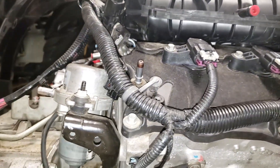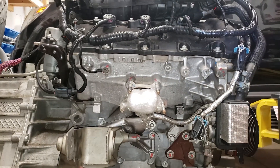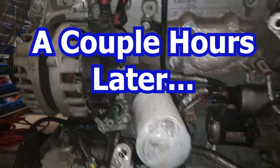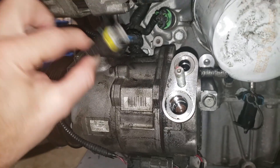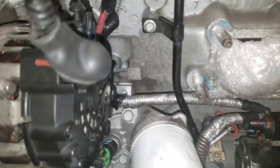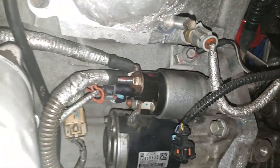This side of the engine is pretty close as far as connections are concerned, so now I'm going to do the other side. This side is still pretty bare — missing an AC compressor, an alternator, a starter, and the big motor mount. Made a little bit of progress: the alternator's on, the AC compressor's on, everything's hooked up. There's a big red wire from the alternator going to the starter, and the starter also has a silver wire that terminates at the battery. The starter is in.